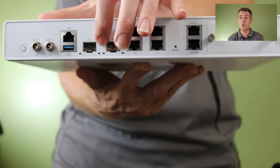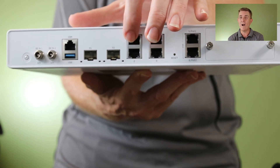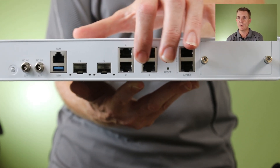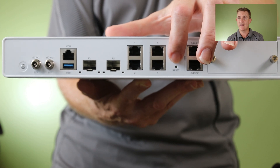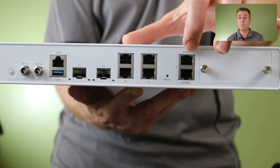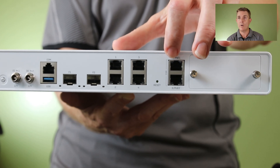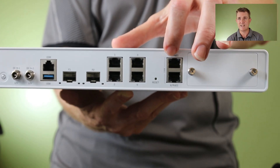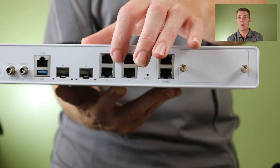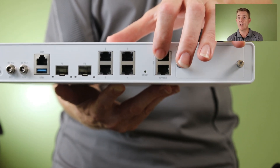The interesting thing with this device is we have two 10-gigabit SFP+ ports, which is really cool. We have got four one-gigabit GbE ports, and then we've got our small reset hole. Then we have our two 2.5-gigabit-per-second PoE ports — these will give out up to 30 watts each, so these are PoE+. They'll power fairly power-hungry access points or anything else you're looking to drive from there. Obviously these can all be configured as multiple WAN or LAN ports — we configured them as WAN in one of our tests so you could test it at two and a half gigabits per second.